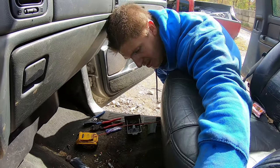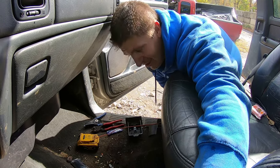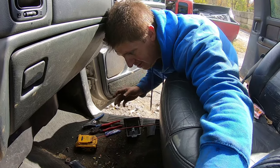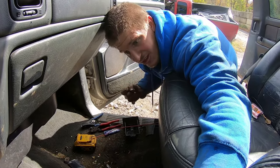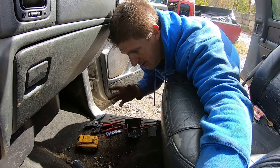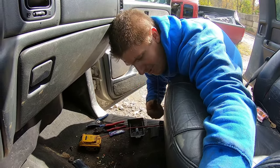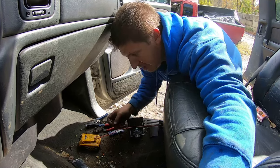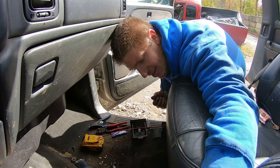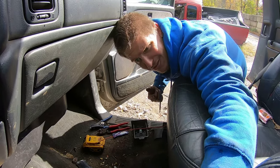Easy peasy! Get all the junkyard seats you want, never worry about it again. In my experience, all the GM vehicles I've worked on — trucks, SUVs, the GMT 360 — all of them use the same color coding: the big orange is the main power supply to the seat, the big black is the main ground. I'll get this one out and celebrate — I found about three dollars in change under the driver's seat.